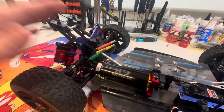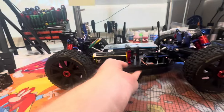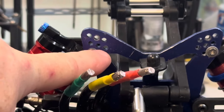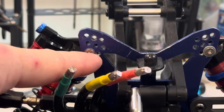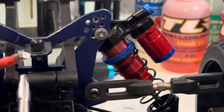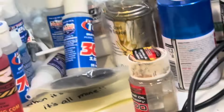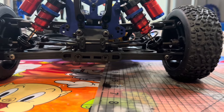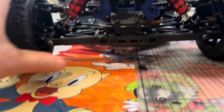The other thing I've also done is adjusted the rear shocks. As you can see from the last video, that one there was way lower to the ground. What I've done is measured the mounting holes - from there to there and there to there - to roughly get it where it'll be in between, then measured from the outside as well to get it the same on both sides. It's actually lifted it up just a little bit more, which I'd like it a bit higher still.